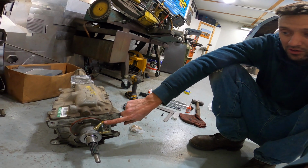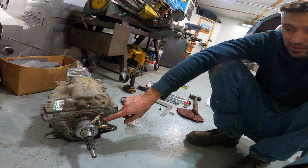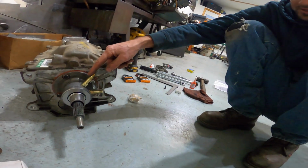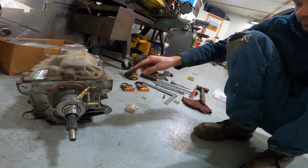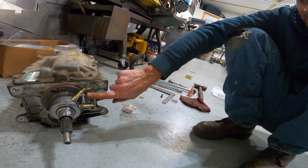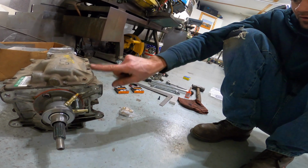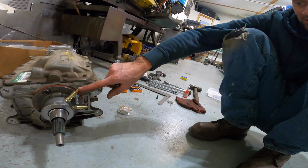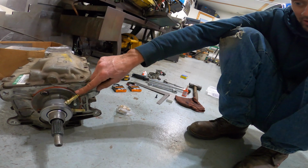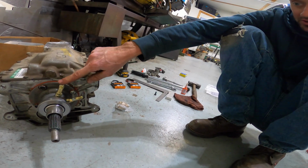We'll take the bleeder off of here because this bleeder will be on the braided stainless line that comes out, and so we'll be able to bleed this outside of the bell housing, like I said, and we'll just route this along the firewall, kind of down the trans tunnel area to a point that we can get to it, but it's also inconspicuous and not an eyesore.